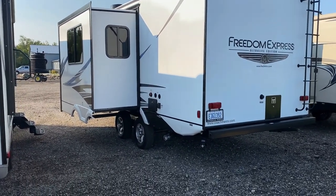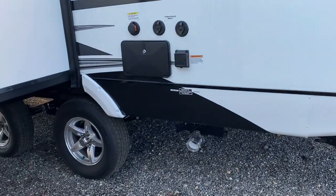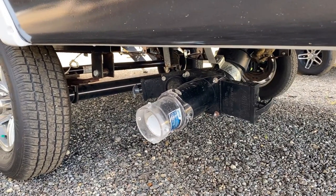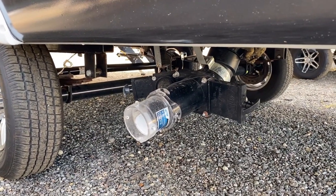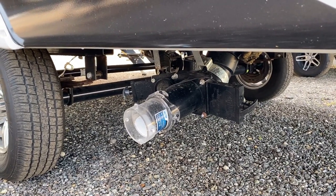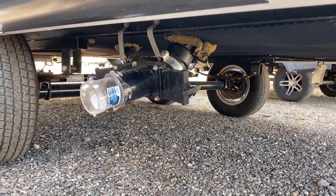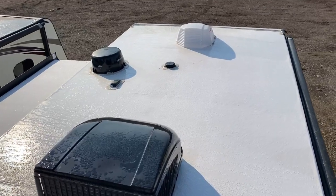The hookups are also in a really intelligent location. You've got a black flush outside shower, separate cable and satellite hookups, but everything you're plugging into is all back here in the rear corner of the RV, which makes more sense. This clear joint in your sewer outlet system is an excellent idea — not only so you can monitor things, but also so you can make sure the line is empty and clear before you unhook. You should always be doing sewer stuff with gloves, but I figured I'd at least point out that little pro tip for you. And that is an enclosed and heated belly.